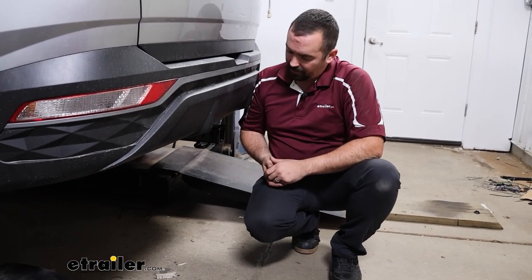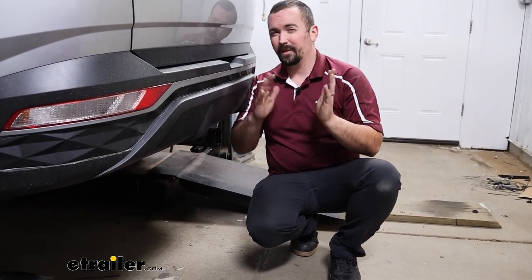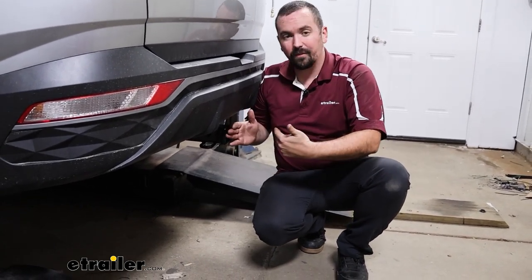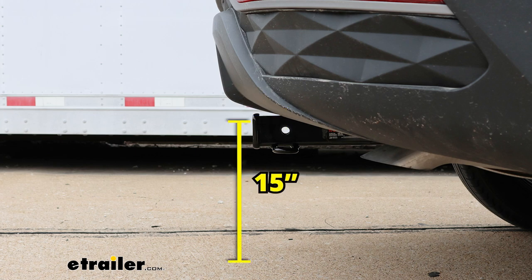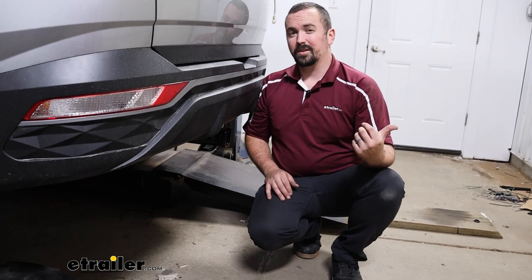I'll give you a few quick measurements so you can choose accessories that work well with your Tucson. For folding accessories like cargo carriers or bike racks, the distance from the center of the hitch pin to the rear fascia is four inches — choose your accessories accordingly. Ground clearance comes in at 15 inches, which is good, but keep in mind that going up an incline will tilt accessories toward the ground. This measurement also helps you determine if you need a rise or drop for a ball mount.